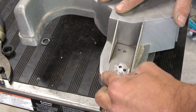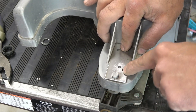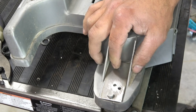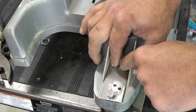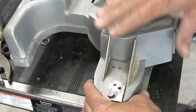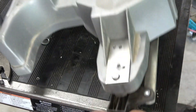So, this is how you install the stainless steel plates. We've got it cut to length and width, and we drilled 5/16ths in from the end, ending up with a 7/16ths hole. You can see just how much flex there is in there. In the video, I screwed up and drilled the two pilot holes for the rivet in the middle. Then I realized there's actually an injected support inside the plastic — I couldn't even see it. There's like an I-beam type support in there.